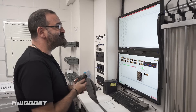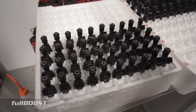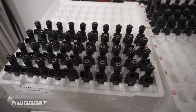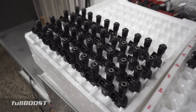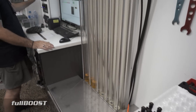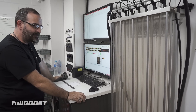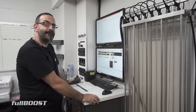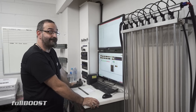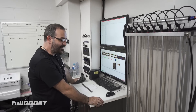And I have seen them as high as 7%. I think 7% under full noise, if you were extracting as much power as you could out of an engine, you could possibly start hurting stuff. And if you didn't have the correct data logging, if you didn't have EGTs in your particular car or vehicle, you wouldn't know any better. On an injector like this, anything requiring injectors this large is making a lot of horsepower, so the window for something to go wrong is only small.